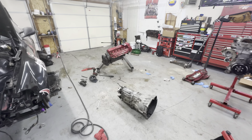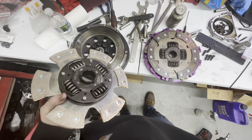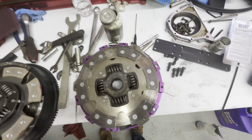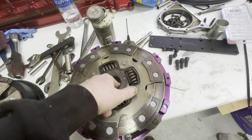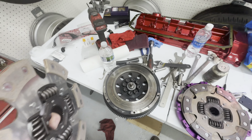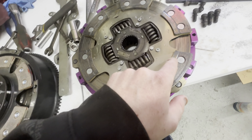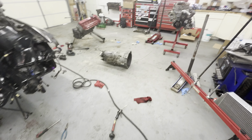We're going to get to installing this thing today. Got everything unbolted over here. Got a new clutch disc right here for the X-Clutch, here's the old one. So a little bit of user error on this - this worked fine, but at one point I slipped the clutch so hard it actually welded the clutch to the flywheel and I had to break it loose, which was not fun. You can see the damage on the flywheel there. I'll clean this up a little bit, toss the new disc in. I ordered a new one just to make sure we didn't have any issues.